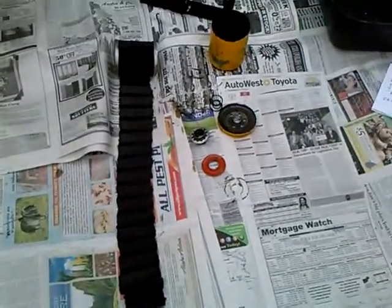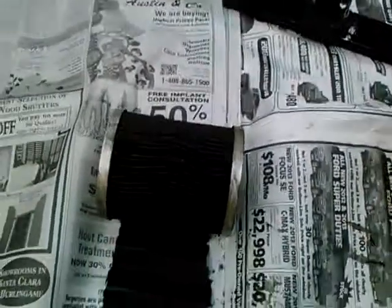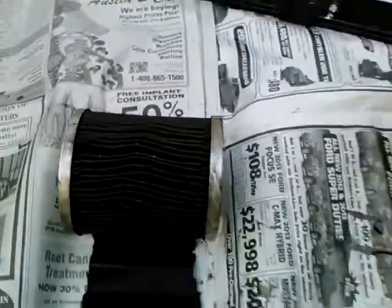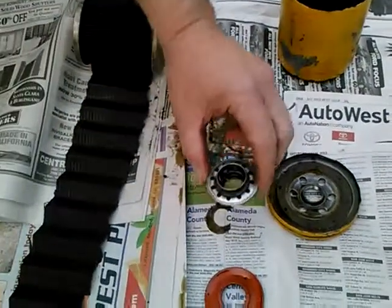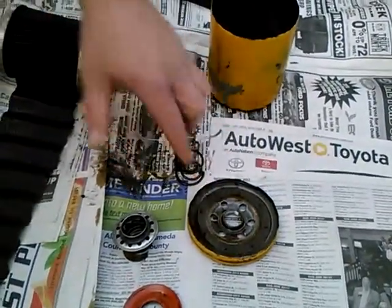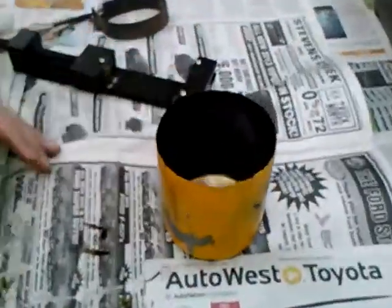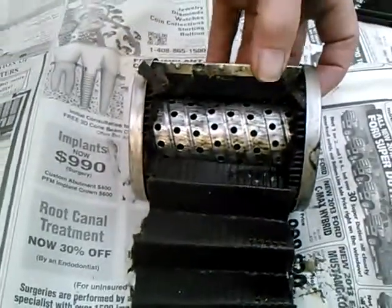To recap: I think this is a Wix filter — maybe from its internal construction someone can confirm that for me. It was on the air-cooled Volkswagen exclusively for over 24,000 miles in a full-flow setup where 100% of the engine oil goes through this filter. The filter is equipped with a bypass valve and an anti-drain back valve. This spring holds the media against the cap, and in the metal container itself, next to nothing. The perforated tube is a spiral construction, and I see no evidence of it collapsing.